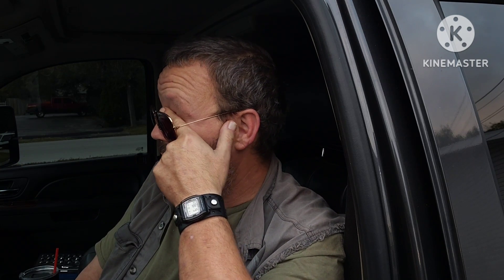Once you get done with that, in the end during my sitting-and-listening test, I'll use a master EQ and tailor the whole system a little bit to get the overall sound how I want it. But by doing it this way, you get rid of dead spots and get a more cohesive result. When you end up EQing with your master EQ a little here and there, the overall sound field will just be amazing — it'll be perfect and you won't have anything that your ears go 'I don't like that.' That stuff all goes away.